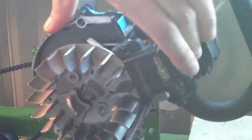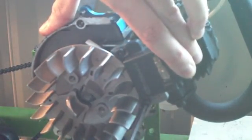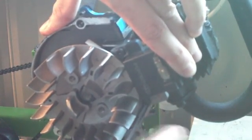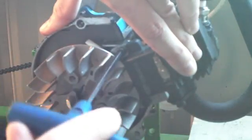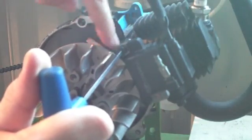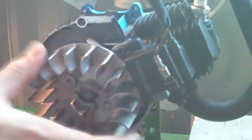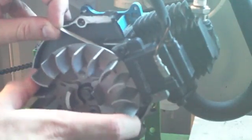And then what we can do is push down on the magneto whilst we're tightening this bottom bolt. And that is going to sandwich in between that piece of business card, which gives us just that slight millimeter gap between the magneto. So now that that's done, what we can do is just rotate, and that business card should just pop out — like so. Here it is.